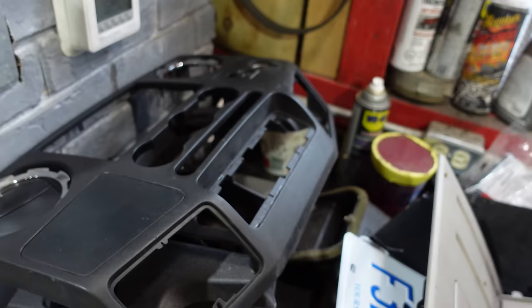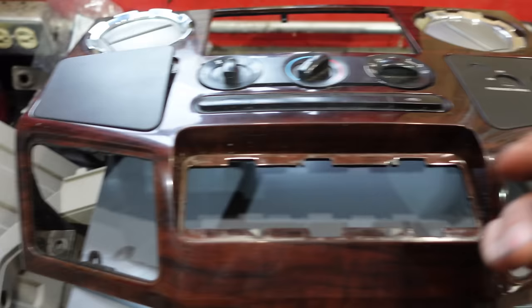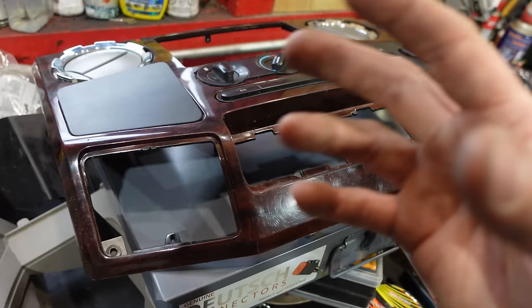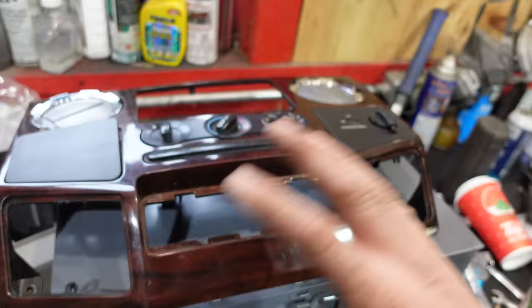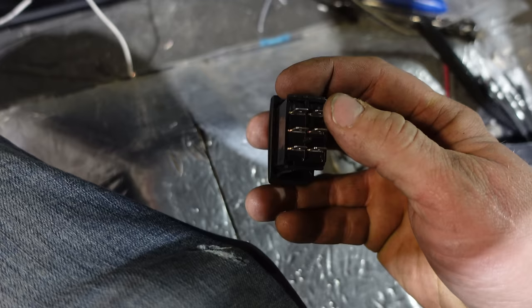The four-by-four switch location on the economy version is blank since it's two-wheel drive, so we can put our airbag up-and-down switches in there, a brake controller, and auxiliaries. There are some hidden ones that go to the heating ducts or something for the center console. We will get our heated seats working once everything else is to my satisfaction.